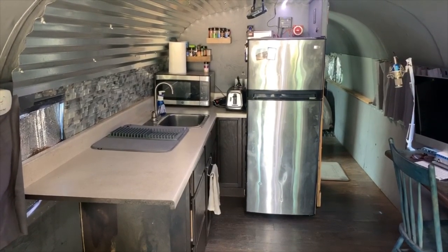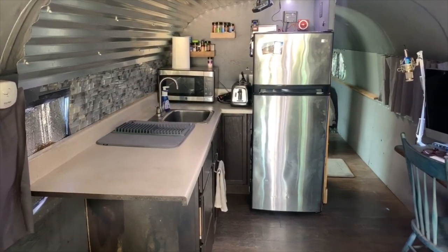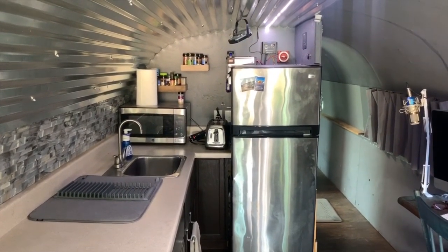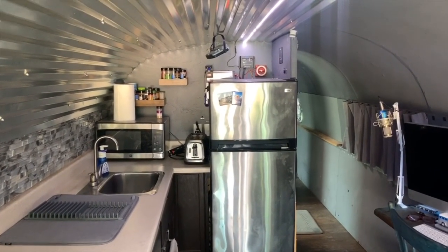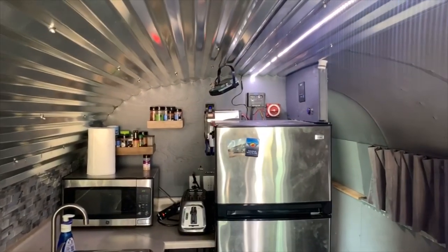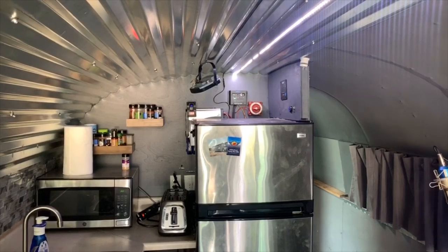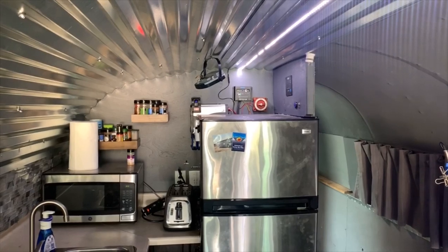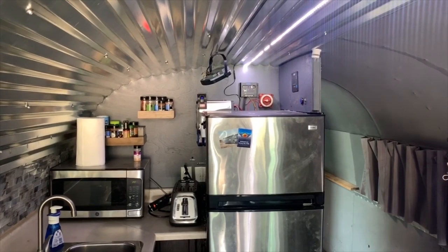We also have an electric coil hot plate she can use if needed. If we're somewhere without electricity, we have a butane one as well. Microwave, toaster, and a power inverter on the back wall — we just installed a new one. The solar panels can be directed via an AB switch on the back wall — they go to either the house bank or the start bank. I have a 1500 amp-hour lead acid battery bank, which is well over a thousand pounds. With lead acid batteries, you don't ever want to drain them more than halfway, so technically I've got 750 amp-hours I can use to keep my batteries in good shape.